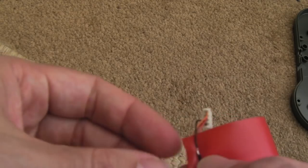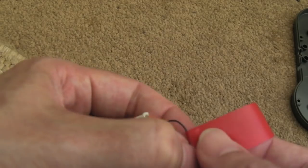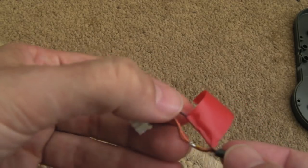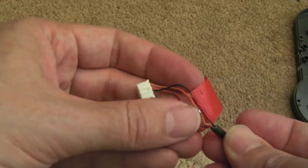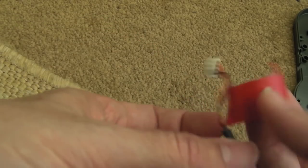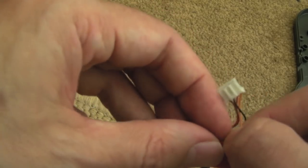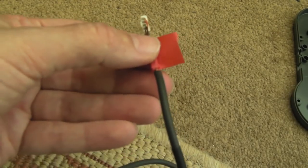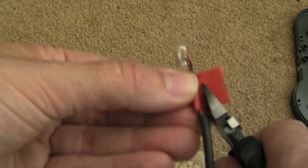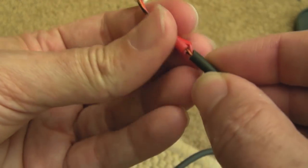That's the main thing, making sure you've got a good solder point, that the wires are overlapped, you've got a good enough solder connection there. Tape the first one, and then just feed this through the gaps. It's a bit easier with this one because we've got a much larger cavity there to slide the tape through without trying to join the tape back to itself. That's it. I'm going to cut that excess off actually, because otherwise it's going to be difficult to get the heat shrink over there if you've got too much thickness with tape. But yeah, that should be okay.